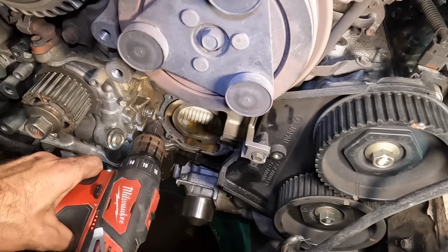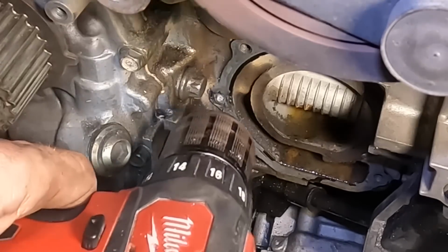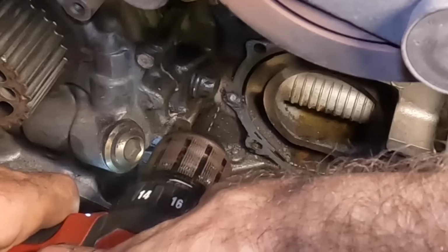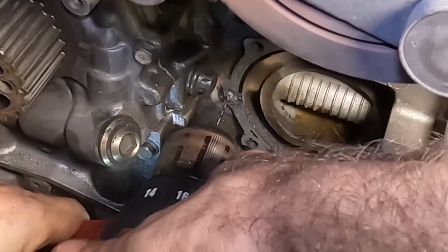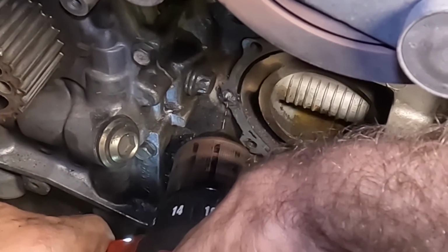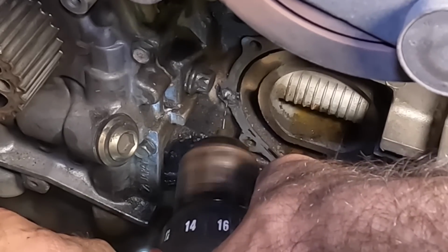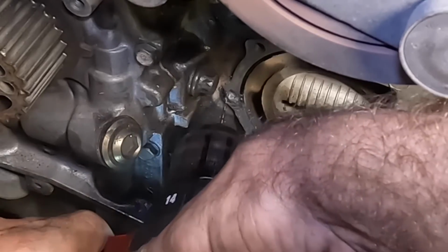Man, well, I do see a nice looking flat spot on that bolt. Maybe I can drill this thing out some. That's all I got left, is to try to just drill it out, see if I can get it close enough to the threads where they want to release. Come on. It's kind of flat. Begin the hackery now.